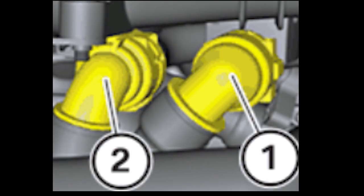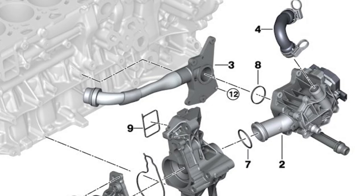When you lift the intake manifold up, there are going to be two connections closest to you — those are going to be the hardest connections to remove, just because of the clip placement holding those coolant pipes on. Use a lot of up-and-down movements, because they are keyed in a way where wiggling side to side won't give you as much movement as pulling the connector up and down.